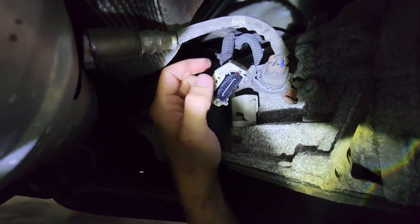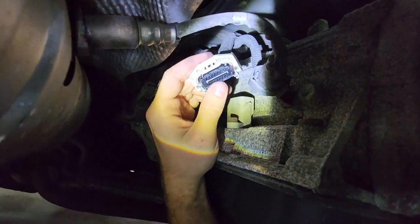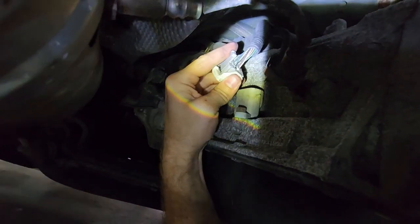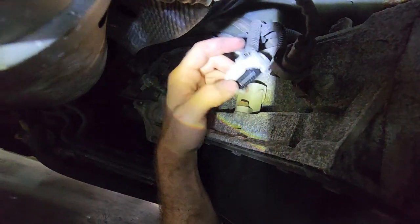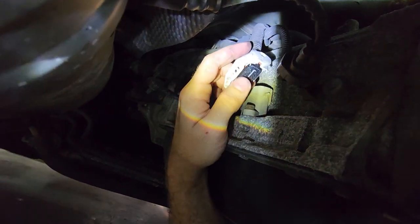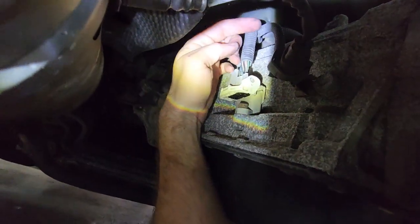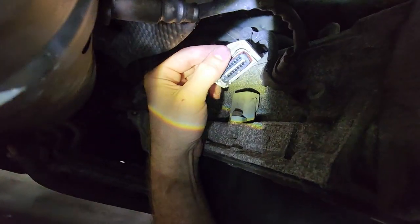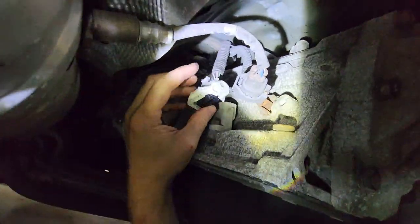So the last part of this whole ordeal will be popping the black lock cover off, and then taking a little deep pinning tool and popping those two terminals out and seeing how bad the terminals are, because if they're super corroded, even with the new transmission side harness, they still may not offer any good continuity between the circuits. So I might have to actually cut back the wiring harness and replace those terminals. And hopefully I've got those on hand, but if not, that's another order from Toyota. You can buy individual terminals. Very, very expensive, but you can.